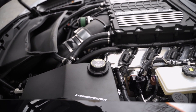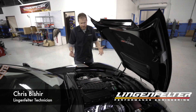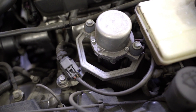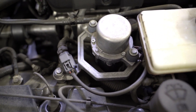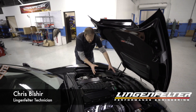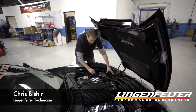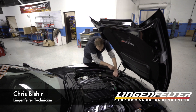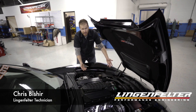For installation, it's pretty straightforward. A factory C7 car will have a vacuum pump in this location right here. There'll be one bolt right here — you'll remove that bolt, set the reservoir down, and install that bolt. There's one more mounting point here; you'll mark that and then drill it, and that'll take care of mounting.